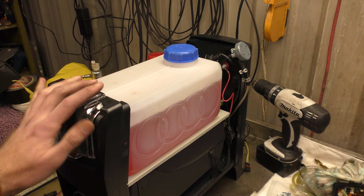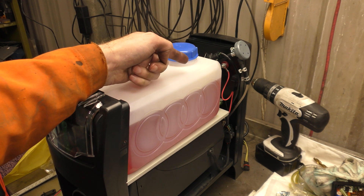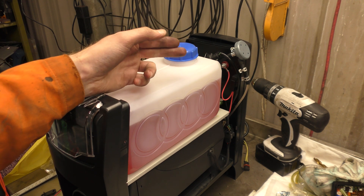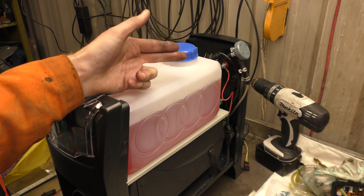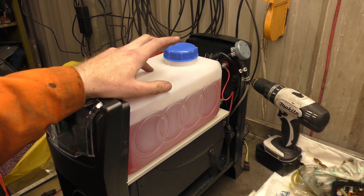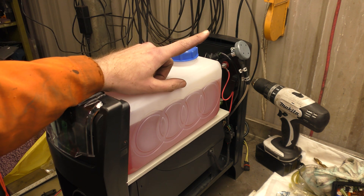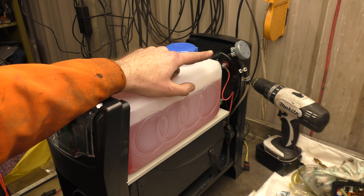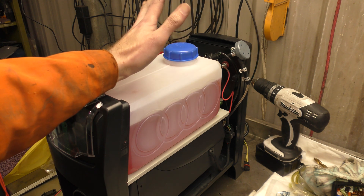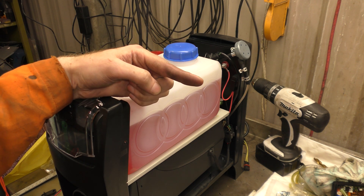I should have mentioned — the damper won't change the sound of the pump itself, because the tick of the pump is still the actual physical module inside the pump moving backwards and forwards. That operation is unaffected. The Webastos all have these fitted, and I don't know why, because it doesn't seem to make much difference in noise. Maybe it helps burning. When we do more Webasto water heater testing we'll see, because the Webasto V is quite fussy — it likes a constant stream of fuel.